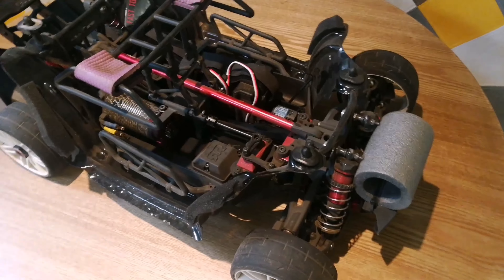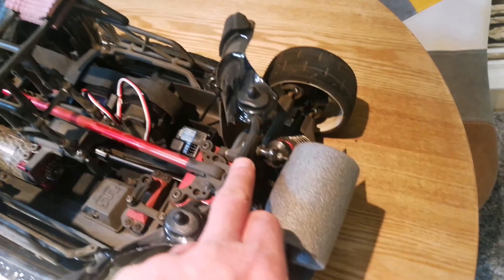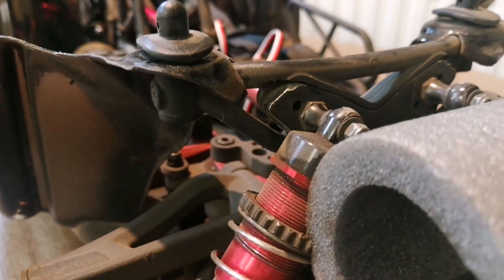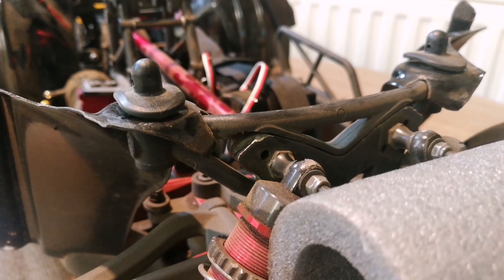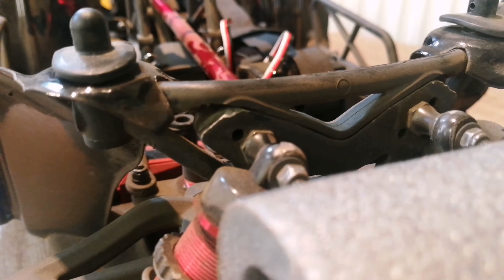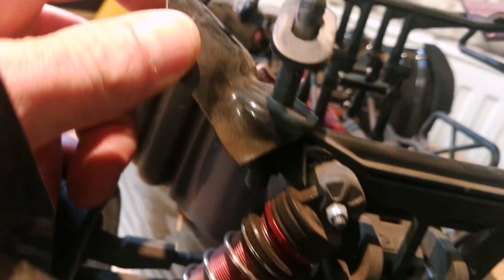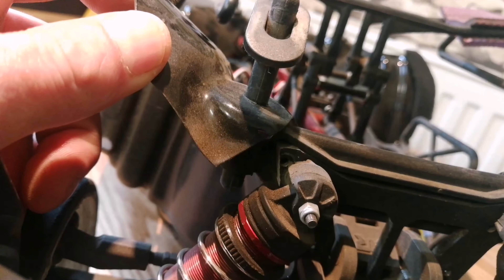Obviously mine has quite a bit of other stuff — Scorched RC fenders for the Centen. These have been modified to fit the Typhoon towers, as you can see where I've had to cut away. It's not hard to do; you just re-drill back through where the standoffs go and bolt them on with the standoffs. Same for the back — I shaved the end of the Typhoon tower down just to allow it to clear.